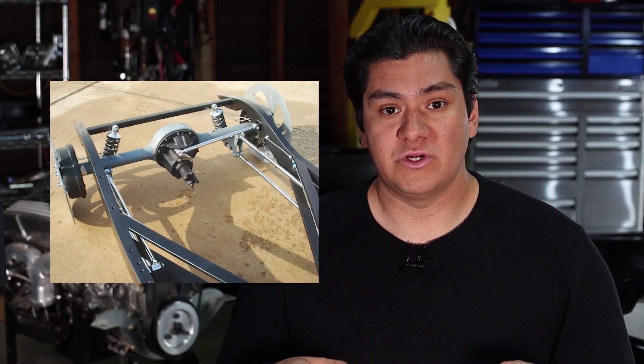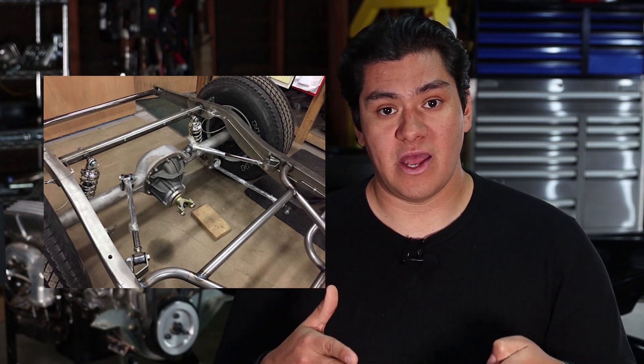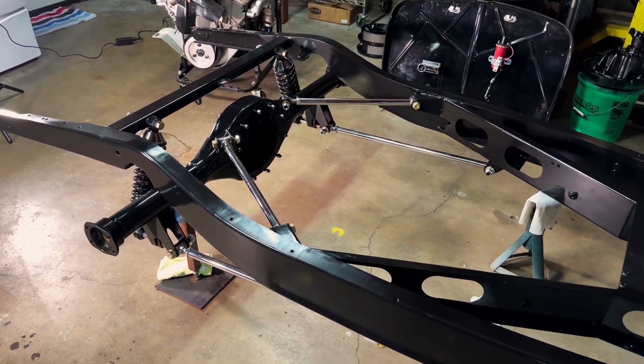When it comes to coilovers you really have two options. You have a parallel four-link bar, which also uses a panhard bar to keep the rear end centered at all times. Your last option is a triangulated four-link — the bottom two bars are parallel and the upper bars are triangulated, and that triangle is what keeps your rear end nice and centered. That's the setup I went with. In my opinion the rear four-link is the most versatile, uses the least amount of parts, and leaves the center of the car exposed for your future exhaust system. There are pluses and minuses to any decision, but know that your rear suspension really sets you up for what type of exhaust work you'll need to do in the future.